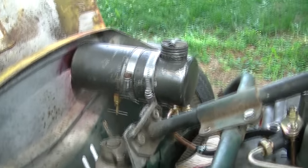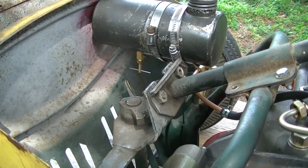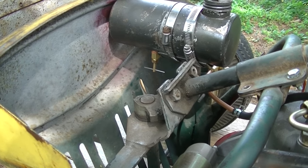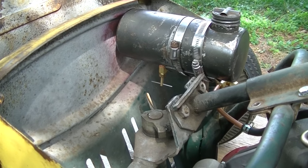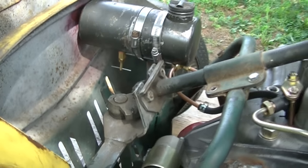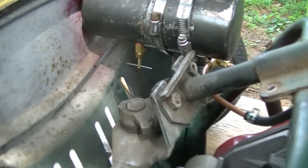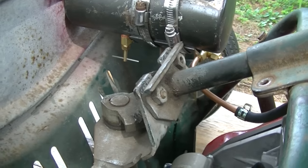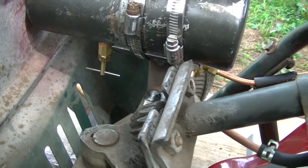Over the forward on the machine, here's the fuel system. I've got this little tank — I genuinely can't remember what it's off of, but it's an older piece of like 70s equipment. Since this machine is so small I didn't have much room to locate a tank, so I chose something small. Since this is just going to be more of a showpiece slash goof-off kind of vehicle, I didn't need a large capacity, and having a diesel helps with that. I think it holds like a quart. I decided to go all copper on the fuel — kind of a steampunk rat rod thing. I dropped by the depot and picked up a needle valve — there's my fuel shutoff. I still have to rig a filter, but it's coming. Just built a little stand for the tank with a piece of angle iron and a piece of square tube, tacked that into place, fits under the hood — it's beautiful.